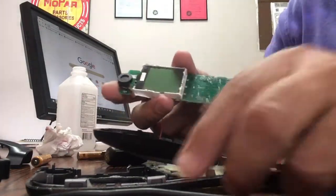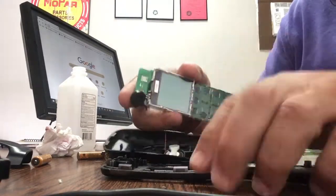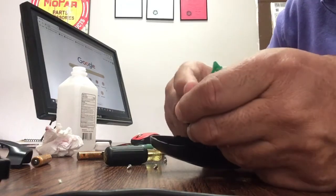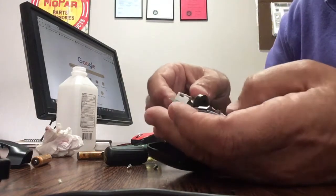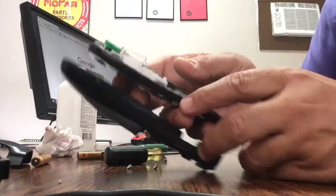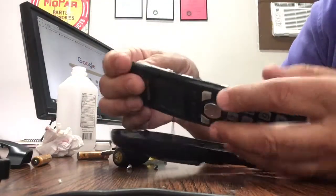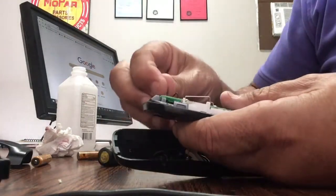And when you put it back in, make sure the speaker, which is that one, goes inside this place for it, which is here. I usually do that first. I put that in there, and the rest of it should go in easily. So after you put it like this, a little push, and this should be in like that. Then start putting the screws back in.